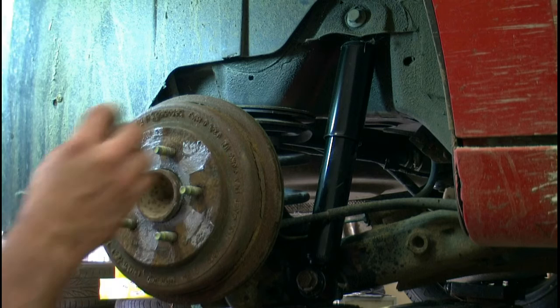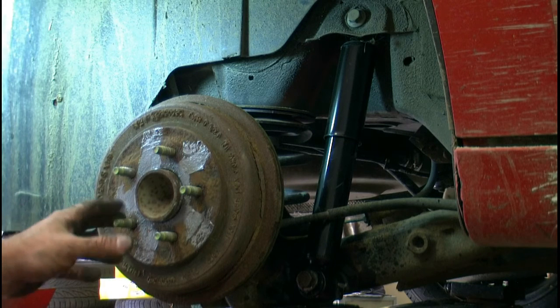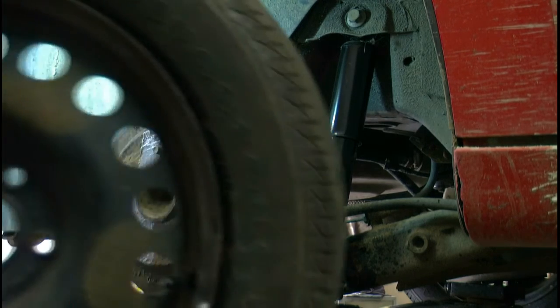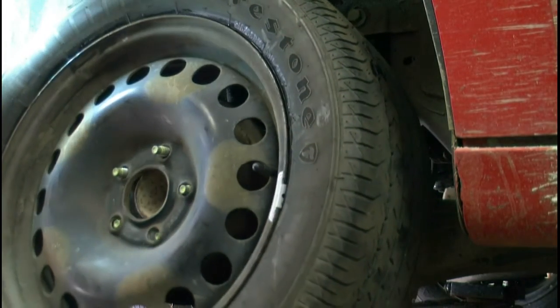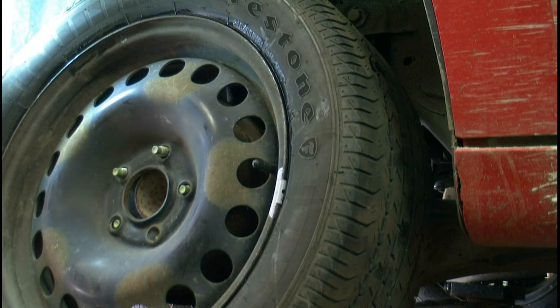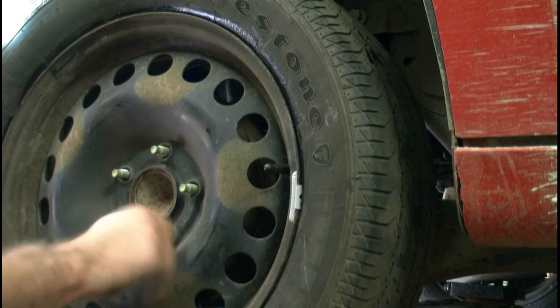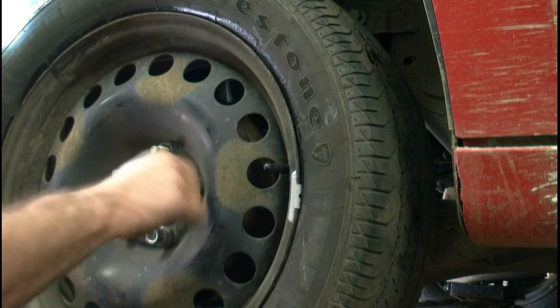When I go to put the wheel back on, the wheel does get hand torqued to 100 foot-pounds and no more than that — be careful. Sometimes the threads get brittle over time from salt getting in, so you may have to end up replacing some of those if you're not careful. I did actually take one of the front tires and moved it to the back because it's due for a rotation — put the better ones up on the front to get them more evenly worn.